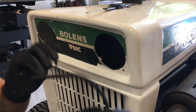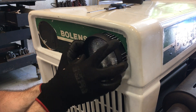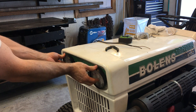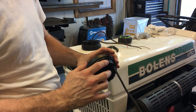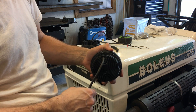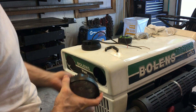The diameter is roughly 4 inches and the outside of the fins is 4 and 1/16 of an inch, so it doesn't miss by much. I'm going to sand a little bit of the fins on the outside, cut this off, and then at the back the screw holes - I could manage to make some kind of new brackets behind to keep them against the frame. What I've done is grind the fins all around, also removed the support there, and just painted the ground metal. So it does fit correctly now.